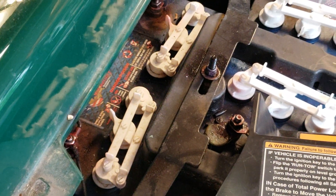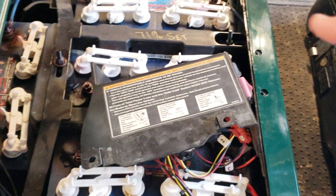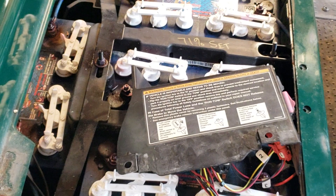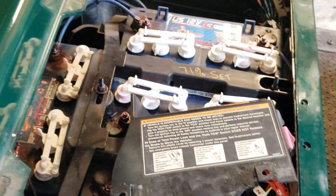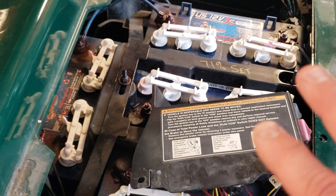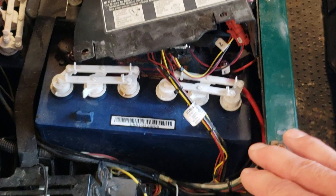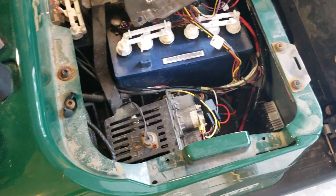The reason you don't ever want to just use one battery directly is that if you connect everything to one battery, you'll have your 12 volts, but you'll be drawing down one battery compared to the others. If you only used it for a horn every now and then it wouldn't be a big deal, but if you get the batteries out of alignment it can cause all sorts of problems with the controller. The electronics on these modern RX-Vs are very sensitive.